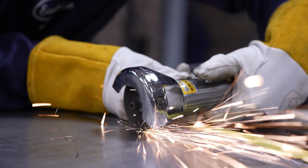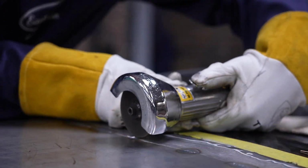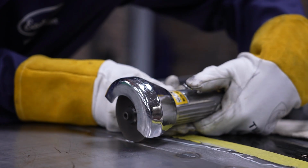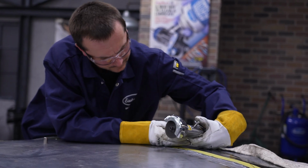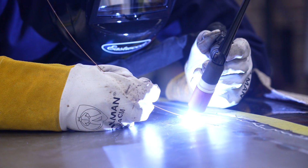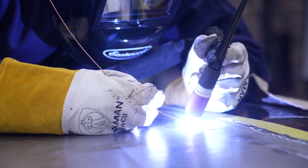While working, it's important to constantly check your panel for fitment as the heat can distort its shape. Ours came slightly misaligned after welding, so we address it by cutting a tack and getting it back into plane by applying pressure from inside the car. These kinds of things should lessen the bodywork later on.